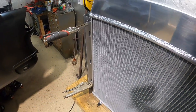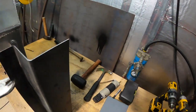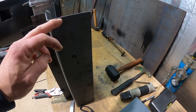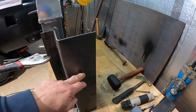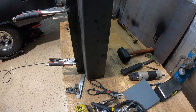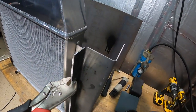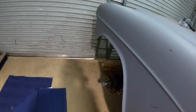I'll spot three holes there, same thing on that side. After that I'm going to measure up — it's probably right around four inches — come out an inch on the top from the bend, and run a radius wheel to put a nice angle on there. That way it's a gusset and brace all in one. I'm not going to weld these brackets on to the frame — I think we're gonna bolt them on. Once I get this all laid out, we'll go over to the car and figure out exactly where we want to land the radiator.